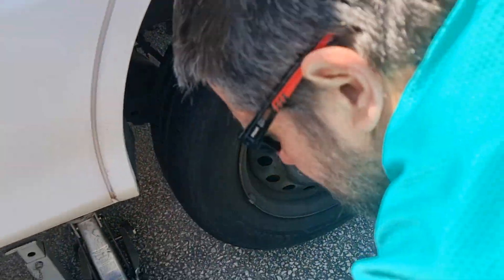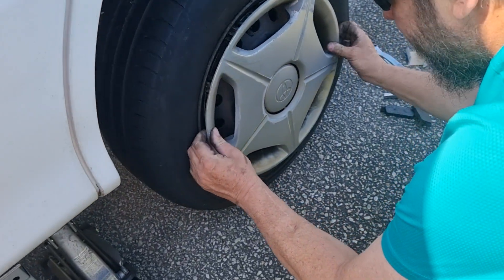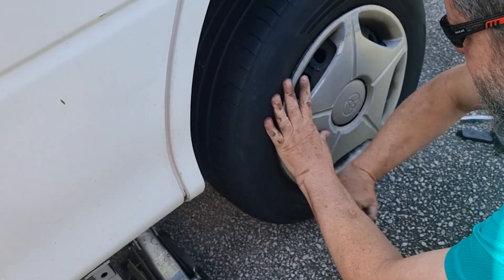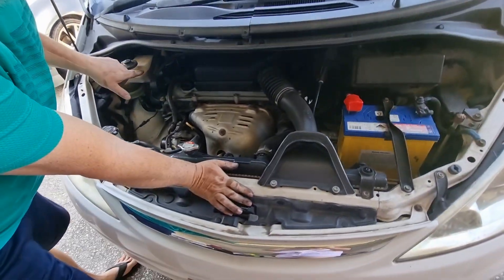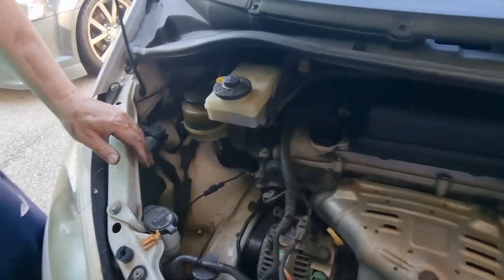After that I'm going to put the wheel cover back on and come back up here. After you're done with both brakes, fill it up to the high level. After you've filled it up to the high level, put the cap back on, pump up your brakes, check the level again.